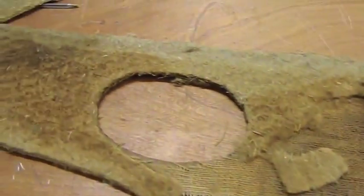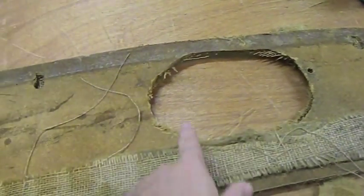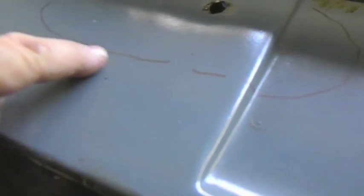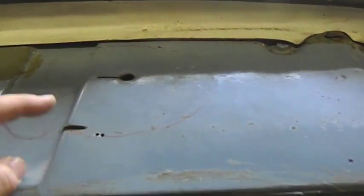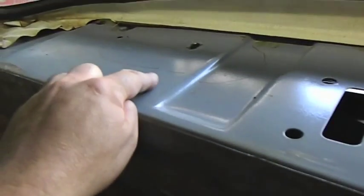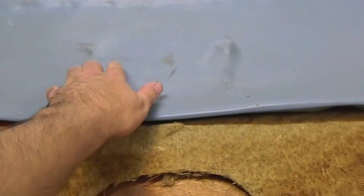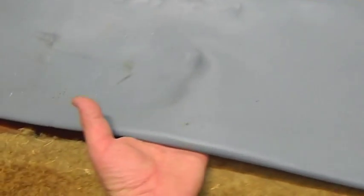I'm going to turn my attention to this parcel tray. Now, this parcel tray has been cut for speakers and you can see it's not all that good - it's lost a lot of structure. So I'm going to use this as a template and make a new one. Speakers in parcel trays scream alarm bells. They've actually marked out where they're going to cut the speaker. I reckon they gave up because it's too hard to cut with the window in. But if these were cut out, it's immediately not roadworthy because you're cutting into the structure of the car. Fortunately, the chap that had this car gave up on the idea and put those 1980 speakers in. This is a hard colour to get, so I'm going to reuse this piece. It's stretched in a couple of spots but it doesn't matter. I'll make up a new parcel tray and staple this from behind. Give it a good clean - you shouldn't see any difference.